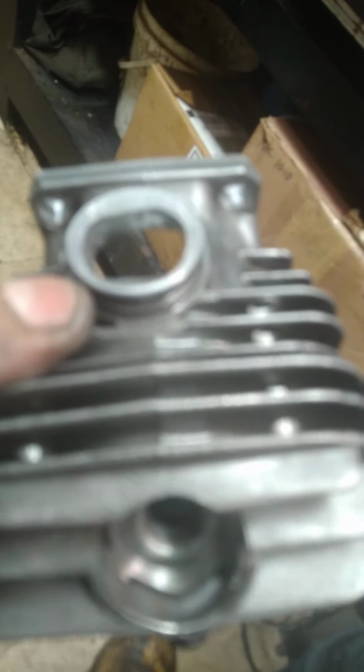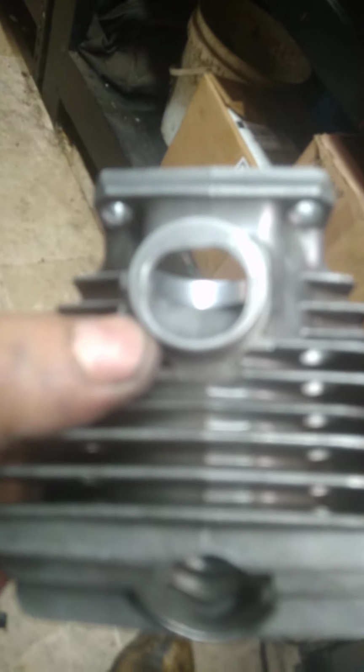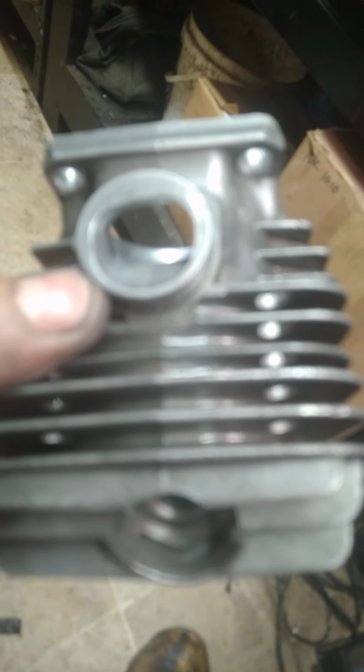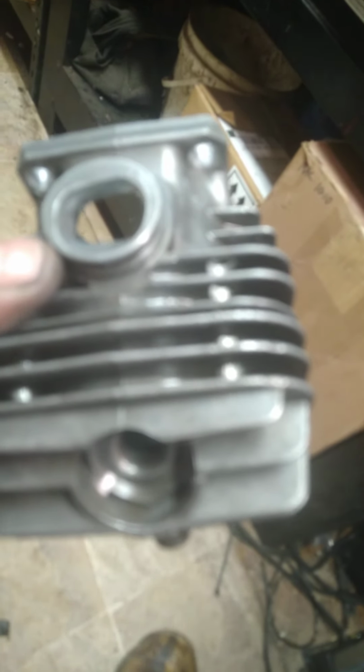As long as you don't leave any trenches or big humps, which is what I've seen several people do on YouTube, and I don't understand the concept behind that. You want the fuel and air mix to stay in suspension, but I'll promise you with that texture there, it's not going to puddle whatsoever. I even saw one YouTuber claim that he had seen dyno results of a rough port versus a smooth port and said the rough port made more horsepower. Well, I'm just going to tell you that's just bullshit. Please just show me in person or show me proof of that.